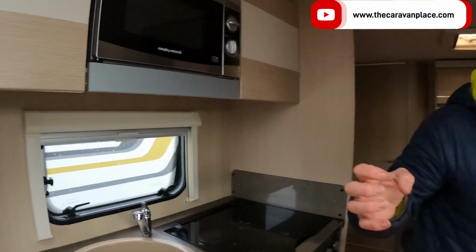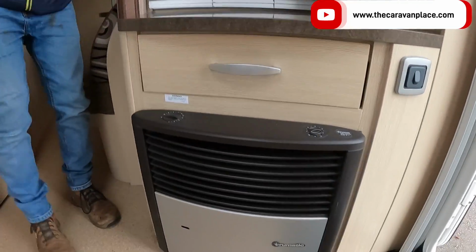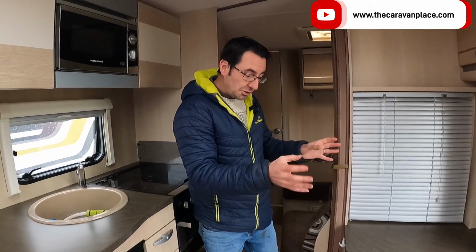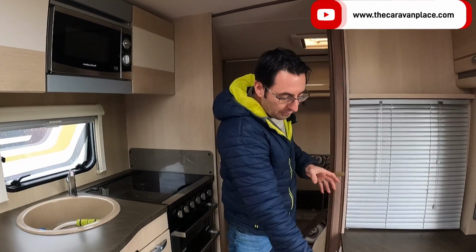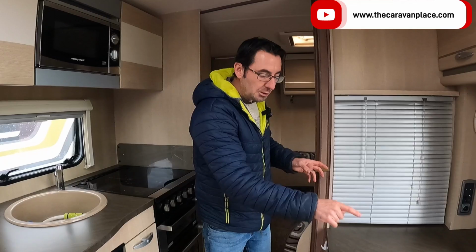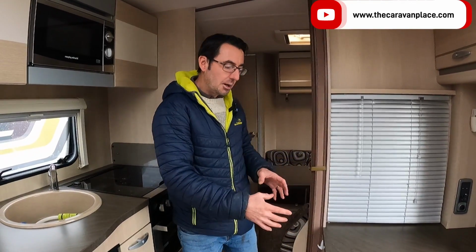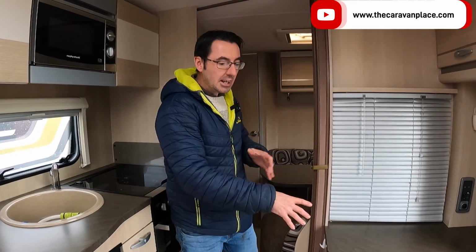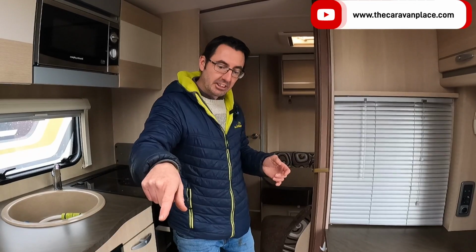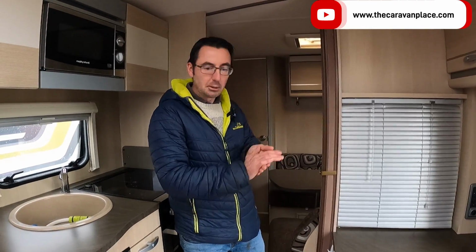If we're looking at a slightly older caravan, we might find a caravan and the heating system is like this, so very much the same as that newer Truma unit that we just looked at. Does the same thing basically, but it just means that we've got a fire in the actual front area of the caravan. So if we put this on the gas or the electric, we can put no blown air heating on, and we'll just have heat coming out the front of the fire. So if we're in the front area of the caravan, it just gives us that sort of warmth feeling from the fire. We can put it onto the blown air again, so it'll have the blown air vents throughout the caravan, and it'll heat all of the caravan up.